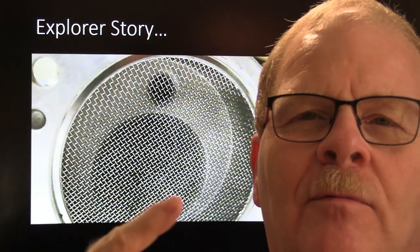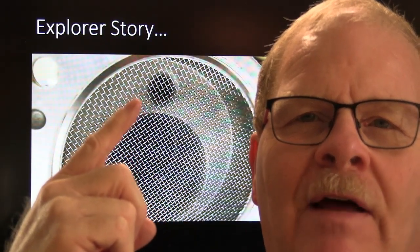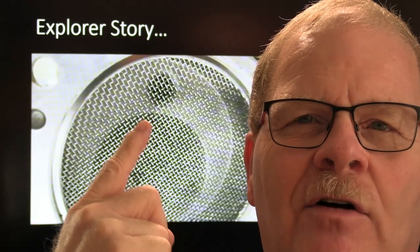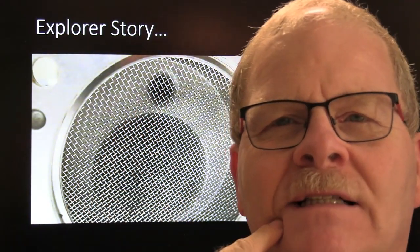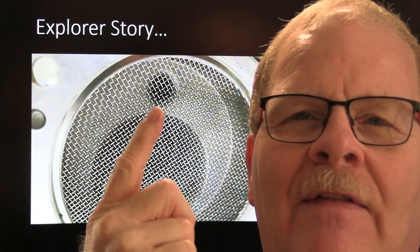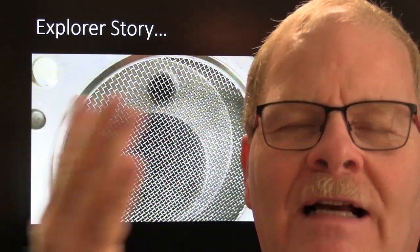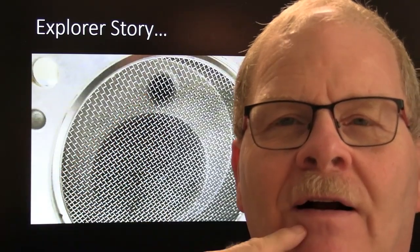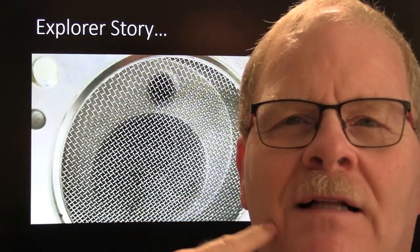And I figured what must have been going on was when he cranked it up periodically, it would fly up here and land right there on that screen and be held against that screen, diverting the air that was supposed to be going past that mass airflow hot wire set. That would make it run lean, because it would report less air than what actually was there. When that roach's wing popped up and got in front of it, it would block that.